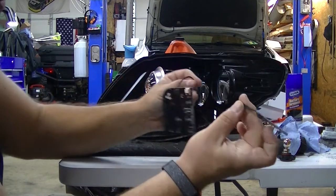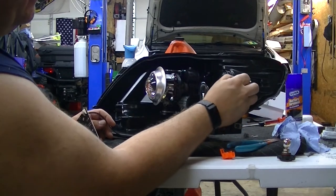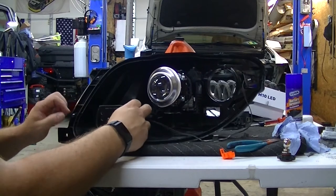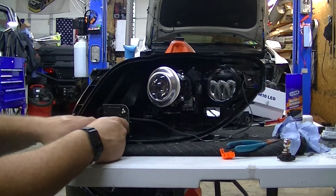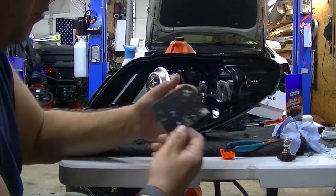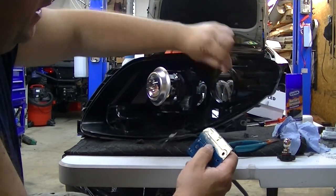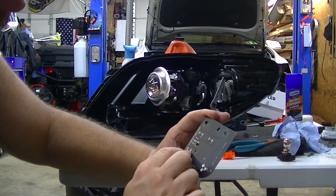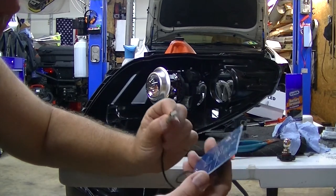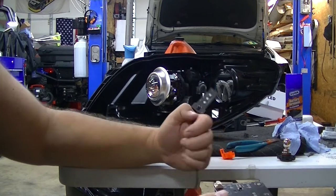The parking light LEDs are surface-mount LEDs on a little board. They kind of mount over here in a little groove with a screw that holds them, and the harness runs around the back. I cleaned them up with electronics cleaner, pulled them out of their housings, and made sure the components weren't corroded. I have some conformal coating for PC boards and I may spray these to seal them from corrosion — they should have been done like that from the factory.